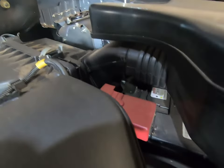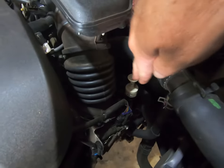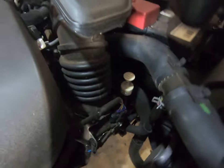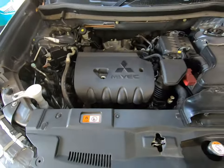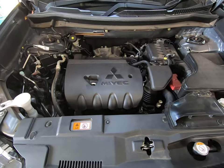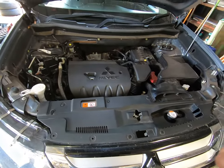There's your battery — most batteries these days you don't even top up with distilled water. And there's your CVT transmission dipstick to check — it's got to be running and in park, cycle through the gears, and there are cold and hot marks. But anyway, I'm digressing. Very simple oil change — hope this helps you guys. It's easy to do in your driveway. Do it yourself, give it a go — you save heaps of money. Thanks for watching.